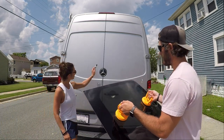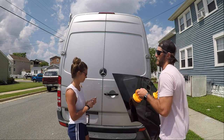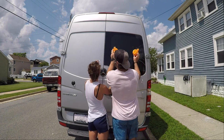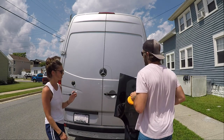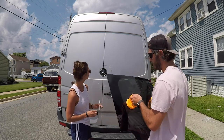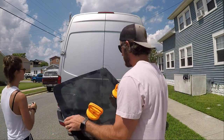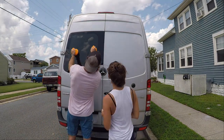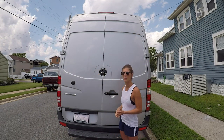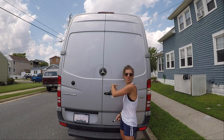We're going to put the window in place and trace around it so we know how far to go with our cutting and, for the adhesive urethane, we know exactly where to put it. Now we know where we'll put the urethane — on this side where we'll glue in the window. We also ordered the piece that goes around the Mercedes emblems so it prevents damage to the van and water damage.